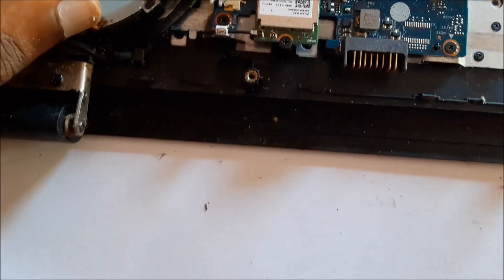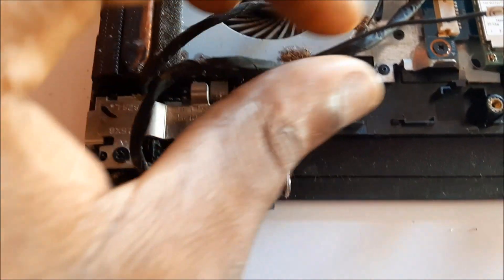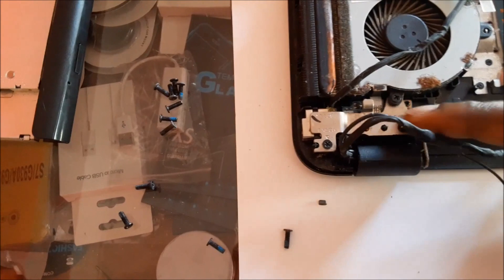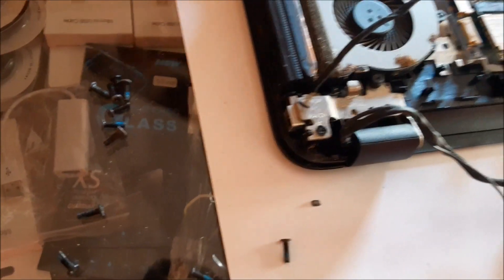This is what we'll plug in right here. So there we have it — this is the port which we will be replacing. I'm already taking out the cable and the cable is out. You will need to remove your WiFi cable and also your video cable as well. Then we are going to remove those screws so we can move back the hinge bottom connection area and replace this part of the port.